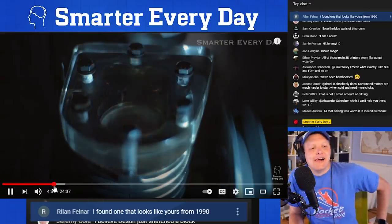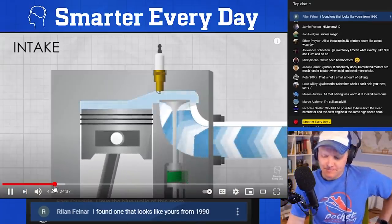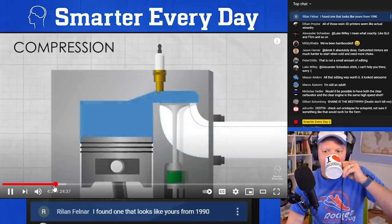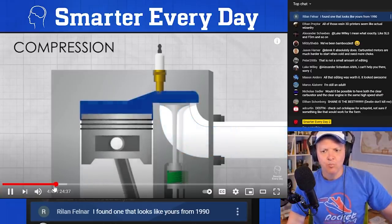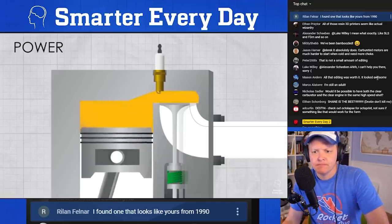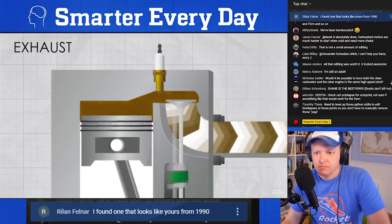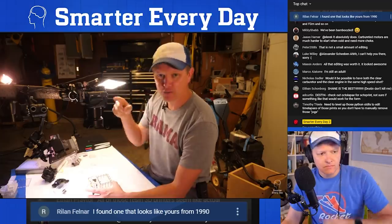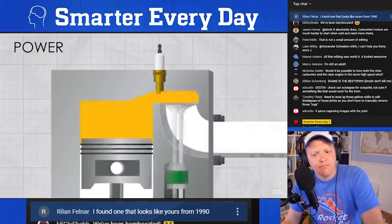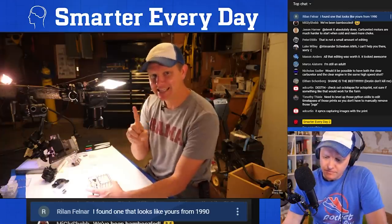Combustion happened inside the cylinder. Basically, there's four strokes to a four-stroke engine. You have the intake stroke, which is where it's pulling in fuel-air mixture into the cylinder. After that, you have the compression stroke, which compresses the fuel-air mixture. And then you have the ignition at the spark plug, which creates the power stroke driving down the piston. And then the valve at the top opens and you push out the exhaust out of that valve and you start the whole thing over again. You have intake, compression, power, exhaust. Intake, compression, power, exhaust. The interesting thing about the intake...